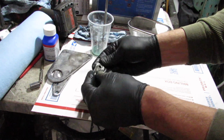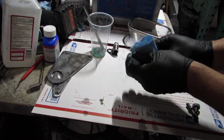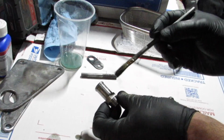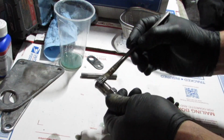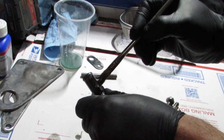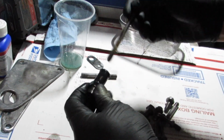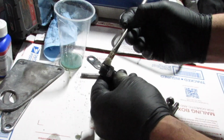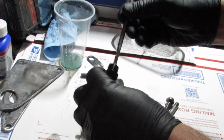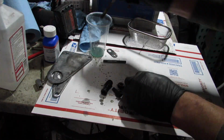To be honest, I'm not the biggest fan of it. I know it looks really cool, but in reality, every time I've done cold bluing, if it sees one rainstorm, one little amount of any sort of weather, it'll immediately start rusting. So I'm kind of reluctantly doing this, and later on, most of the things I cold blued, I ended up painting or covering up.